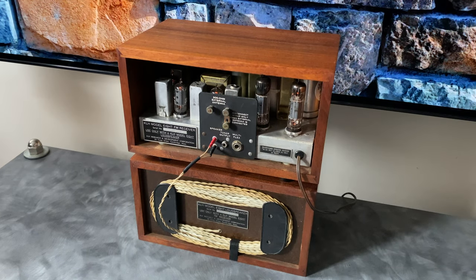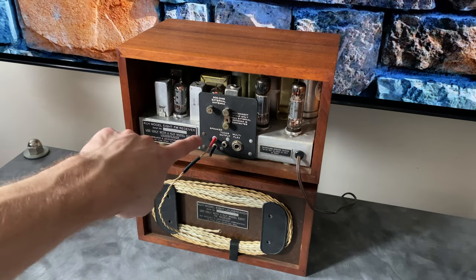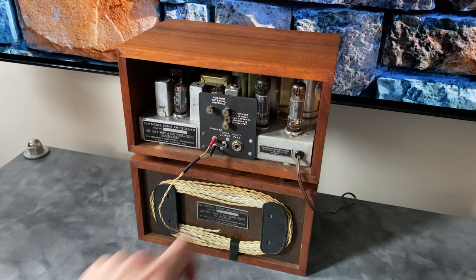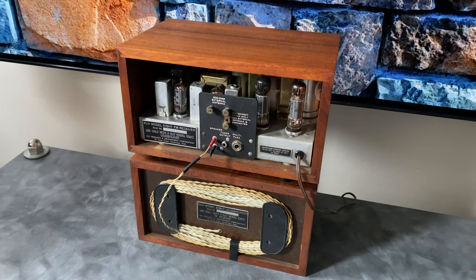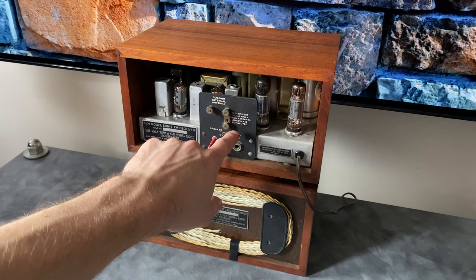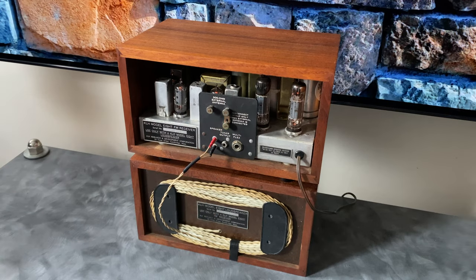There's not a whole lot to look at on the back of this unit — it's pretty simple. I've got the speaker cabinet plugged in here. These two connections are for the optional Model 13, which makes this into a stereo unit. The strap can be undone, which bypasses the internal antenna and lets you run a 300-ohm external antenna across those terminals. Let's spin this thing back around and take one final look at this unit in action.